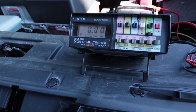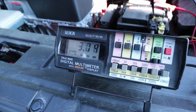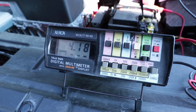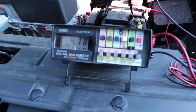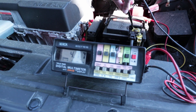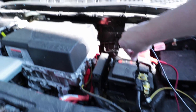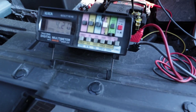Let's have a look — the meter's on zero. If I just get my probe and touch it onto the negative side... I'm pulling four volts. That's nowhere near where it should be — it should be around 12. So what I'm going to try next is connecting the 12 volt battery charger and see if that actually starts the car charging, because the car is still not charging — there's nothing indicating that at all.